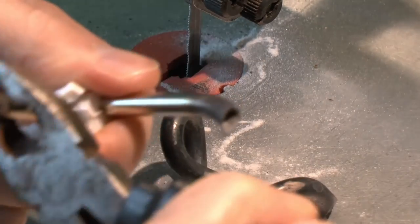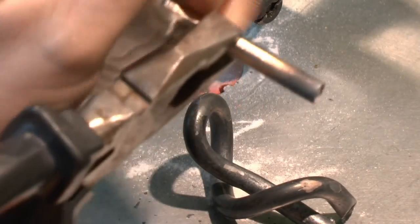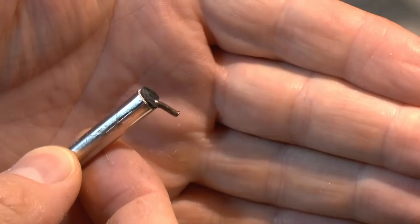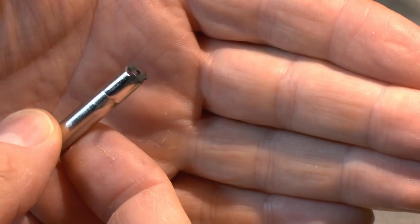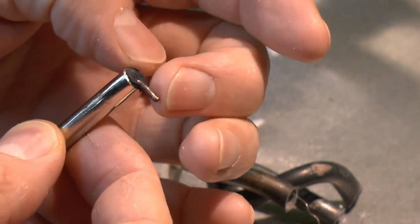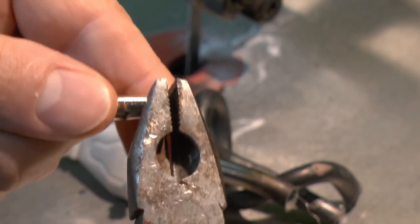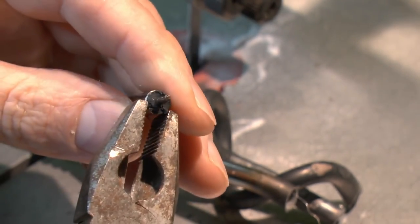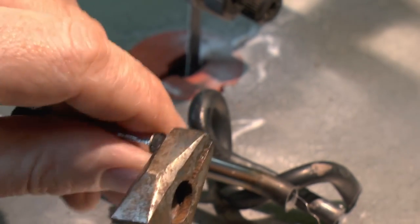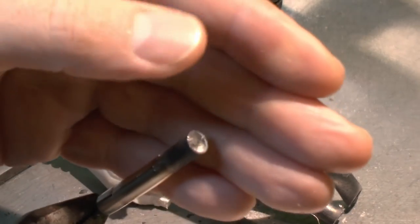As you can see here, it's just the two tubes going up into the top, and there'll be some kind of connection at the end — again that's pretty typical. So that's the end of it: it's just the end of the tube, there's a sealing compound fixed into the end, and there's the actual centre wire coming out. Of course that's what's been bent over — it's normally straight through like that. And again that's pretty typical for things like oven elements.